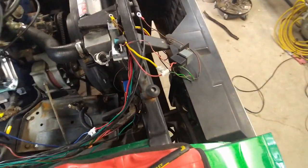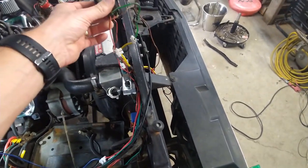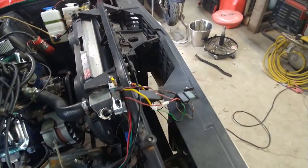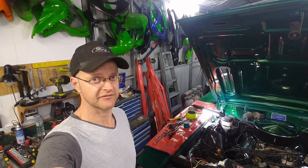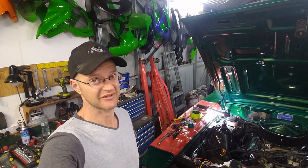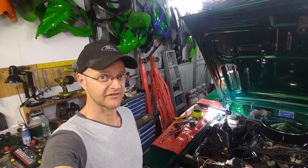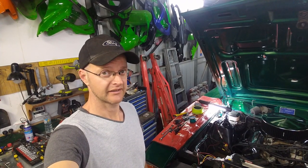I'm going to upgrade all of that to these ones and once I've bench tested all of this, I will tidy it all up. I'm going to have to do something about this driving light relay system too that I bodged together all those months ago when the car was just sitting in the shed. Mental note: don't try to run the signal for the relays in series because it just doesn't work — it means you get one relay working or no relays working. So I relayed the signal from the thermal switch in parallel through both relays evenly and everything works!